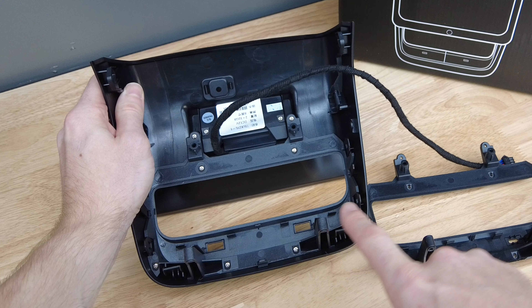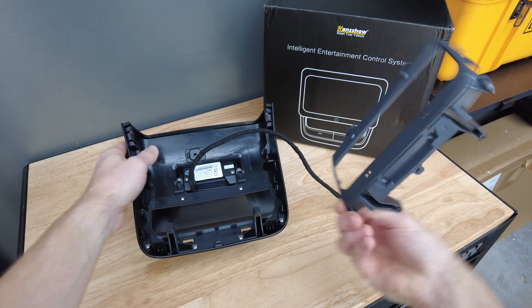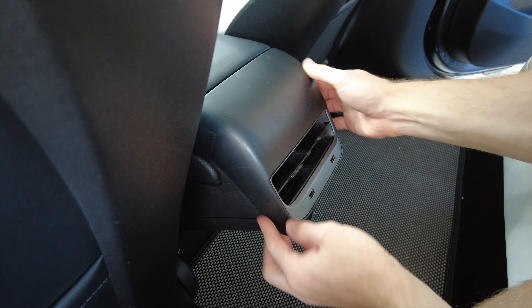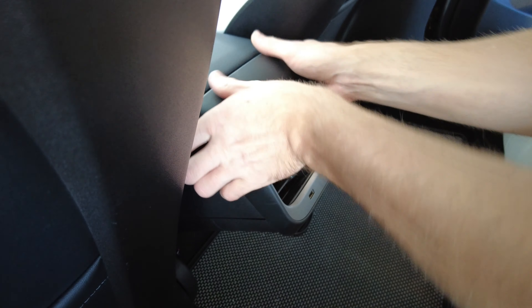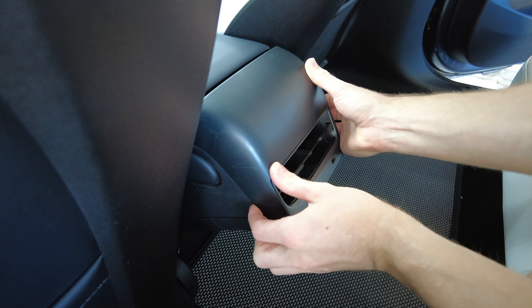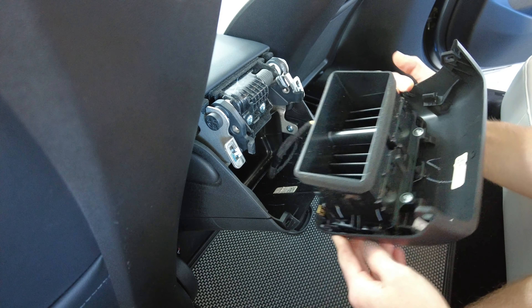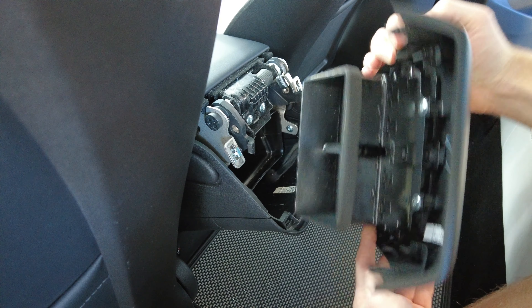You can see each screw I had to take out to release this gray plastic tray — it's not too difficult at all to swap out the trays. Next we first have to pull out the rear AC control box. It comes off fairly easily by gently pulling from the top and bottom of both ends. You'll hear some clips snap free. Then disconnect the USB wire by pinching on the cord and pulling it free.